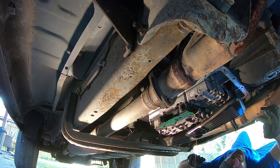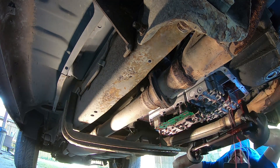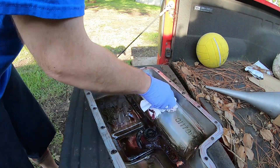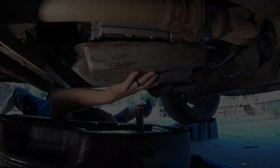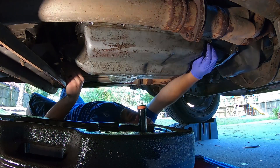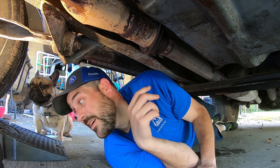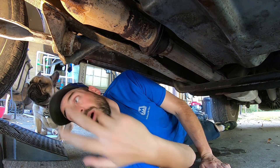Okay, that's the pan dropped. Now we want to get rid of the filter — it still has fluid in it. It just pushes into place; make sure it's still got the grommet on it. There's a little bit of wear here, which is common for where your filter sits — it'll kind of rub. Other than that, looks good. We've got a drain now. We're just putting four bolts in for right now. Now that we're here, we dropped the transmission pan and drained it — that was one of the first steps.